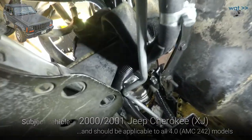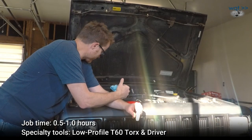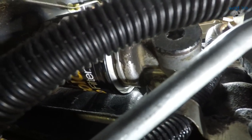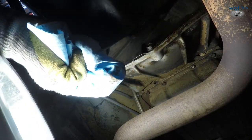What Chrysler provided was a right angle adapter that allows it to unscrew and remove from the back. Unfortunately that adapter does have O-rings in it, and after 200,000 odd miles in 20 years those O-rings fail. One symptom will be oil leakage from right around that area accumulating on the bottom side of the bracket. Another is that you may see oil dripping from the back of your bell housing and it looks like it's got a rear main seal out.